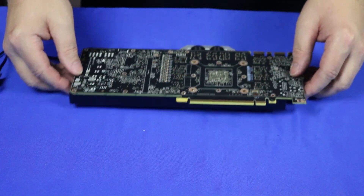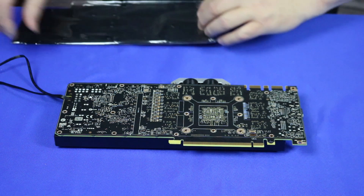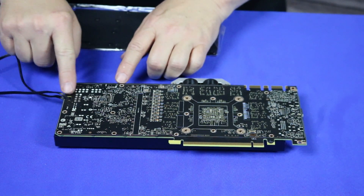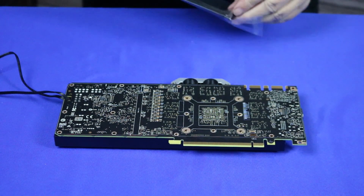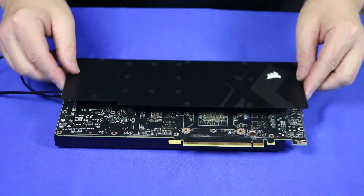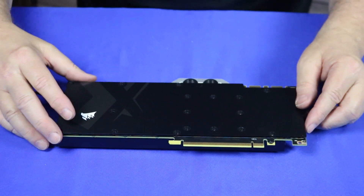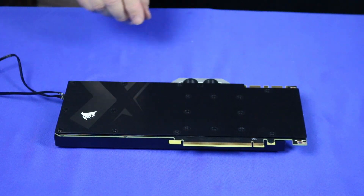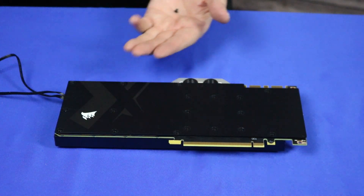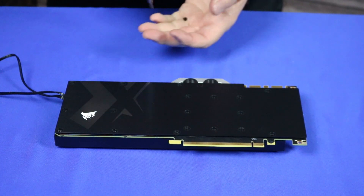It fits under nice. Then you take — see, I was right — it comes right out through here. See where that little notch is? That's right where the cable is supposed to come out from. Take the new back plate, see which way it's supposed to go. Of course, I had it backwards. Goes just like that. Then we take all of our screws and go ahead and screw it through the back plate into the heat sink itself.